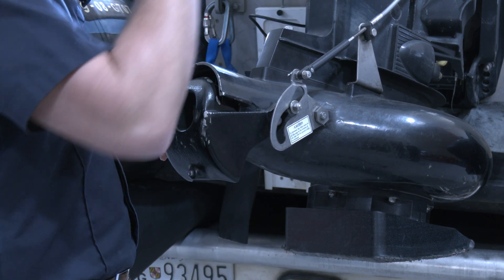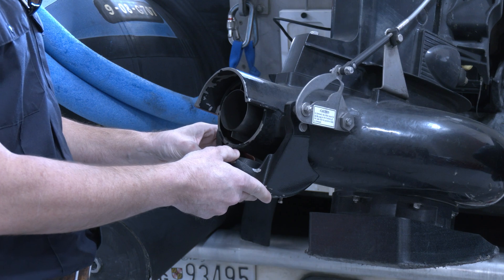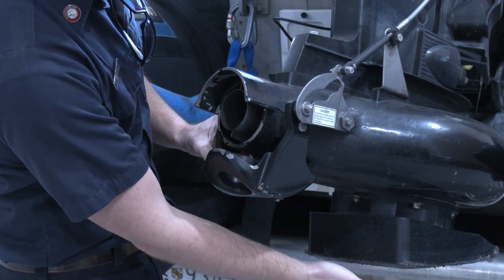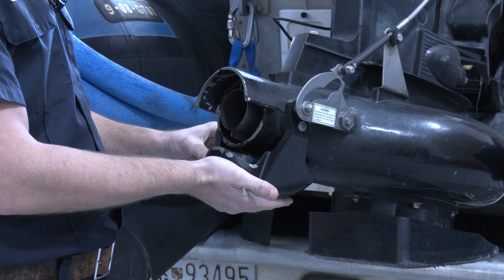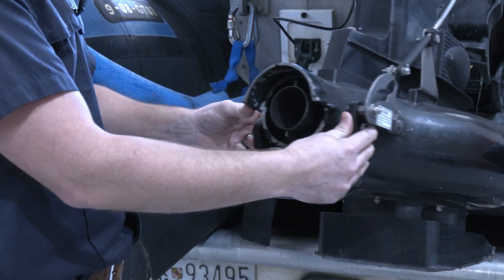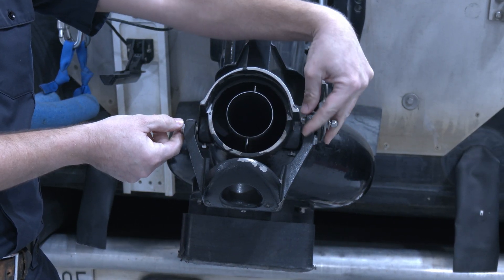When we're running these boats in forward gear, the reverse gates are tucked up underneath the exhaust. The problem is if we hit a rock, it strikes the intake first and then comes back and hits the reverse gate. All the way at the back of the boat, the motor rests on this reverse gate — and it's just cast aluminum — so when that happens these tend to bend. When they bend, these ears here fold out and wind up binding on the pins.